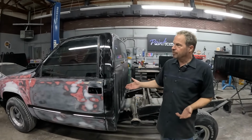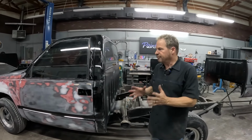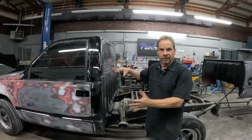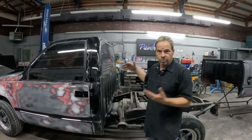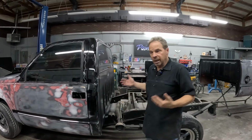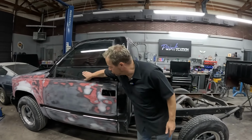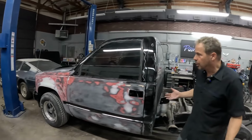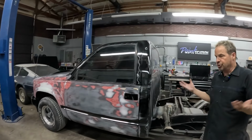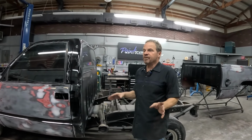Anyway, he wanted a Zed Sled style paint job on it, and he wanted it super flat and shiny. The way we do that is to make it flat and then prime it and then put the paint job on it. The paint job is the lens into the bodywork, and it shows us what's underneath. So all of this is just flattening it out, straightening it out, and we'll put a high build polyester on there and then block that out and shoot it, and it'll be good. In the meantime, there's some other stuff that's going to happen to it.